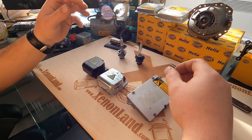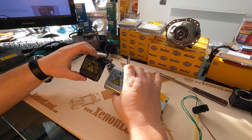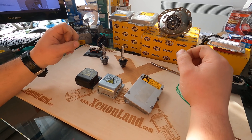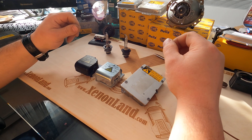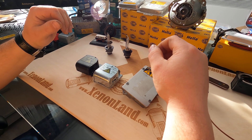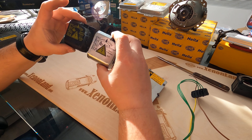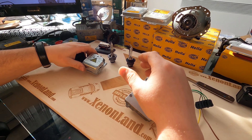Today it may seem a really stupid question, but I will answer whether these two igniters are interchangeable and the same. Because we are getting every day a lot of calls where customers are ordering one of these igniters and boldly stating that they need either the black one or the silver one. There are some customers even saying that they already purchased the other one and it didn't fit. I will show you that both igniters are indeed the same.